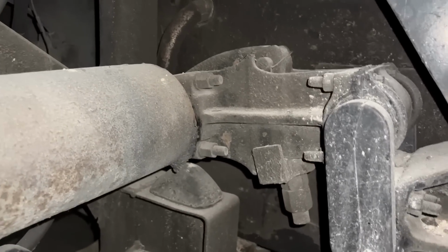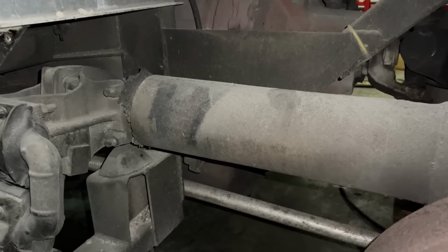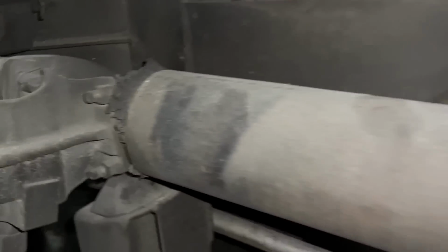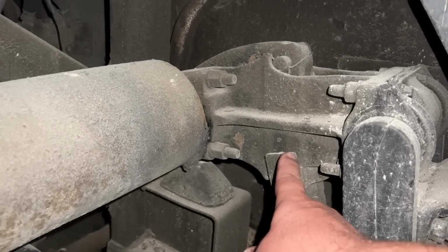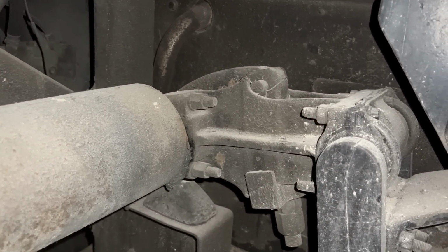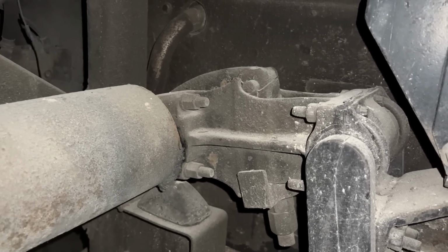Okay, so we went to adjust these torsion. The suspension on this is called the Torsilastic or Flxelastic, depending on how it's in the book. But the rubber springs are coming out there. It's a big twisted spring. And we can adjust the height of the body that way it sits on the axle by adjusting these, and we can run these screws up here. It pulls this down and it raises the bus up. Unfortunately, it's about an inch and a half lower on this side, and about an inch and a quarter on this side and an inch and a half on the other side lower.